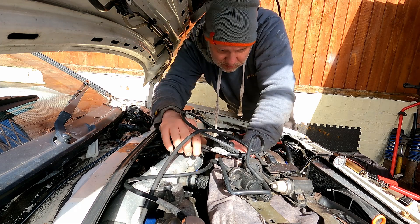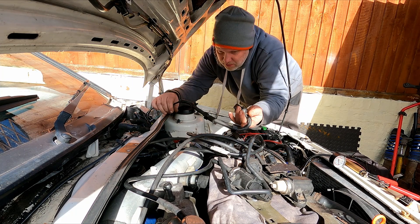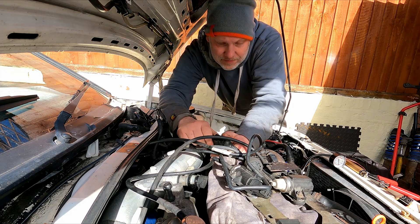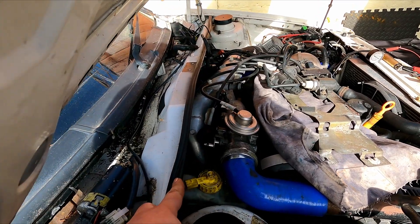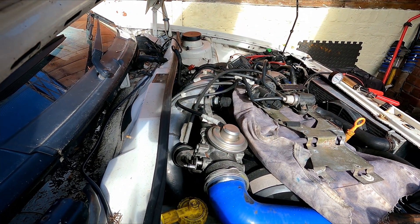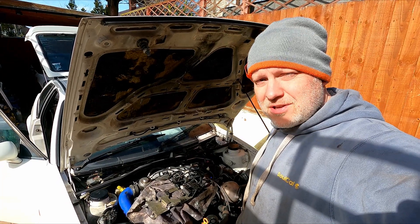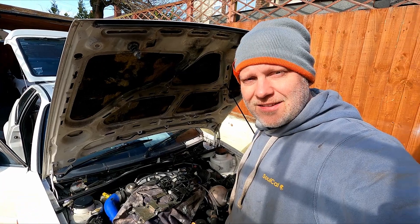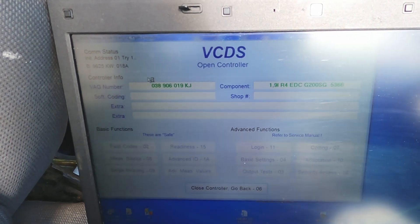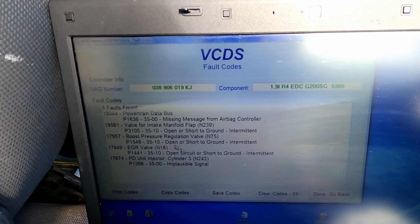Servo vacuum — everything's on. The only thing left to do is the connector — I've lost it. I've already extended the wiring up from where the ECU goes. The first test is always going to be the shutoff valve — that's a good sign, that bit works. Now I need to check the other bits and pieces, so I'm going to break out the diagnostic machine. Going into engine — ignition is already on. I'll need to change the VIN number, and of course there are a load of stored faults, some to do with valves that have been open.